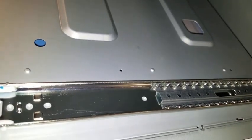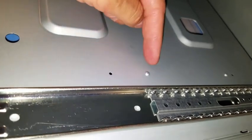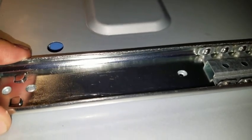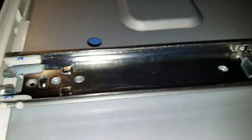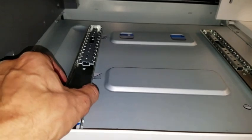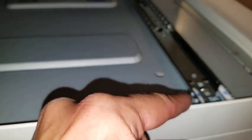To install the metal rails inside the copier, first locate the three metal divots. Next, slide the rail until the third hole lines up with the divot. This will lock the rail into place and expose the screw holes. You are then ready to screw in the rails when they do not move to the touch and the plastic parts are towards the front of the copier.